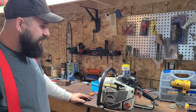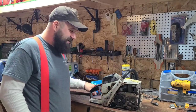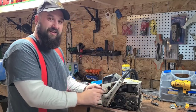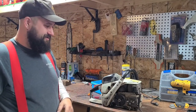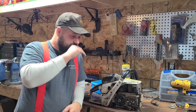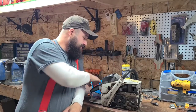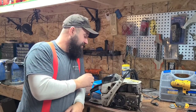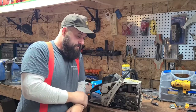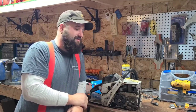I want to run this thing. I went to go run it this morning and I can't get my screwdriver in the high and low jet. This thing's super rich, which is probably why it still runs so good. I can't get this thing to tune because I can't even get my screwdriver in the low jet. I'm not sure why, so let's have a peek — we're gonna run this thing stock.